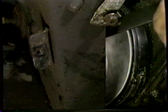Okay. The servo started to pick up there, so now what we'll do is we'll loosen the servo off by two flats. One, two. That's freed up the servo, so we'll take the locking nut in to the adjusting nut. Okay, now we'll tighten the locking nut against the adjusting nut. Hold the adjusting nut and lock the locking nut, and that's the servo adjusted.